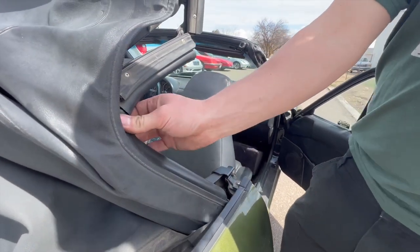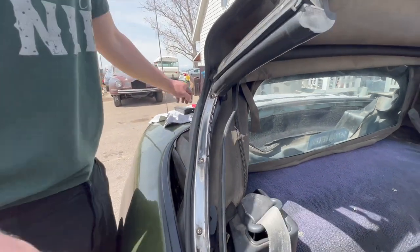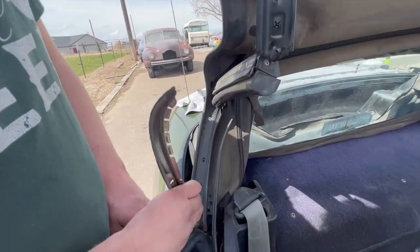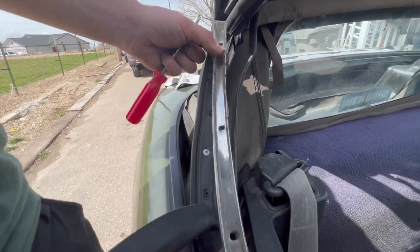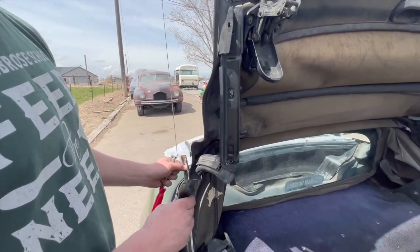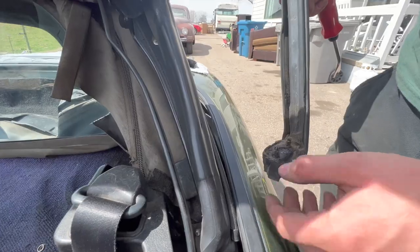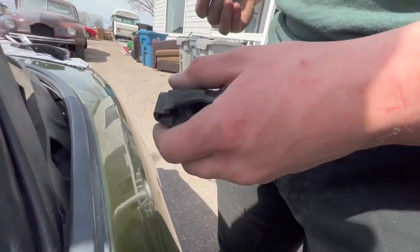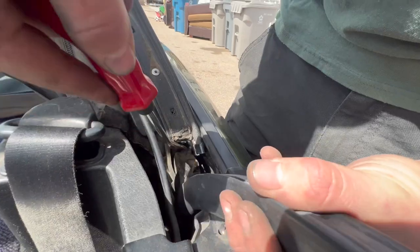Now we're going to do the same thing to the rear section of the rubber seal — we're just going to fold it back so that we can get to the metal frame. If your weather stripping is in good shape, it's not a bad idea to mark around the screw heads. You can see the left marks because the weather stripping frame has some adjustment to it, and if you don't get it on right you can have some leaks — especially if you're reusing old but still okay weather stripping, it won't seal against the door as well as it could. The bottom has push-in fasteners, so we're going to want to use our trim tool to get it between the frame and the seal and carefully pry it out — it should come pretty easy.